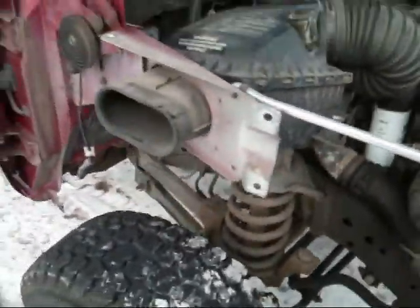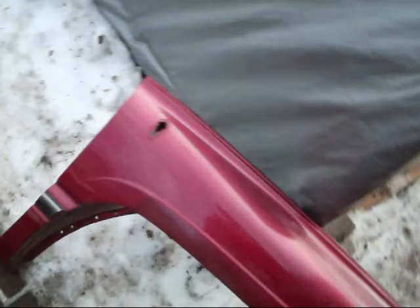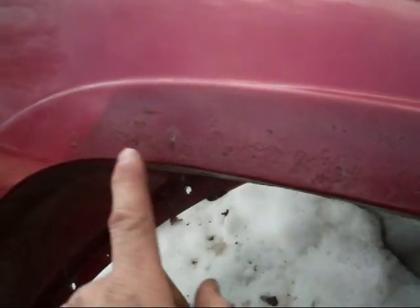You've got to take the battery out and unbolt the airbox from it. Why am I replacing the fender, you may wonder? Here's the old fender. It looks fine, but you can see right here — I've touched it up a little bit, but it's a little rusty. Most all auto body rust is from the inside out. Ain't a lot of light in there, but you can see it's real rusty on the inside.